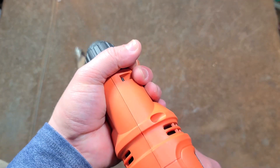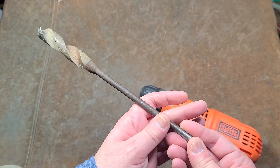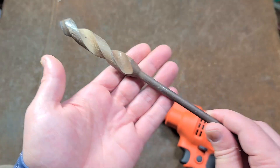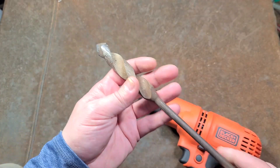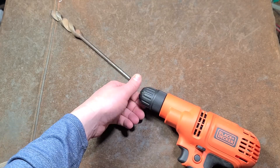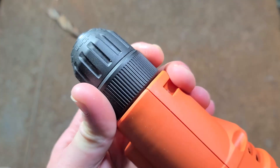It's actually quite stout. The chuck is going to be one of the weakest things here, and I'm going to do a demonstration. I have an installer's bit — a three-quarter inch bit. They're called installer's bits because they're for soft materials and cheap for a long drill bit. If you want to install cable TV or security camera system wires, you use one of these. They have a little hole so after you drill your hole, you can tie an Ethernet cable or whatever you're pulling through, and then pull the wire back through the hole. But with the round shank and quite a bit of surface area, they're notorious for slipping. The problem with hand-tightened chucks is you just can't get enough pressure on them to prevent these types of bits from wanting to slip. Besides that, I think this drill isn't bad, especially having a spindle that's at least tight side to side.